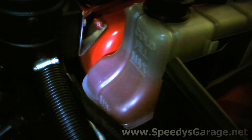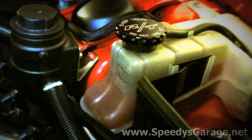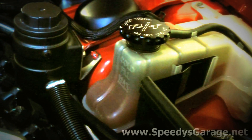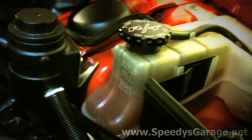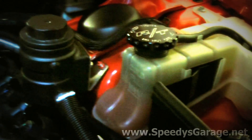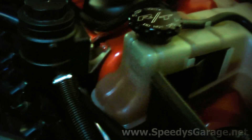One more time at high load — as you can see, the coolant will eventually come up and come right out the cap. Even with the cap installed it'll do the same thing. As you can see with the cap on, the coolant's still rising up in that overflow bottle. For good measure, I did replace the coolant reservoir cap with a new one and still had the same problem. What happens is as you're driving and getting on the throttle, that coolant comes up and actually comes out the cap and makes a big mess.